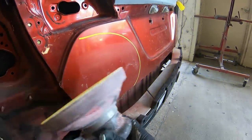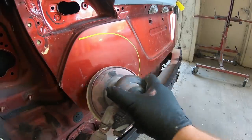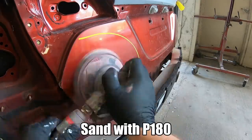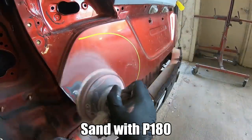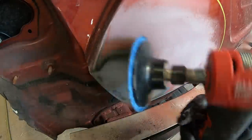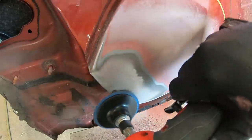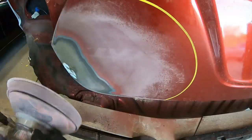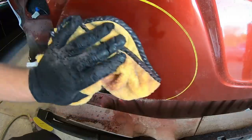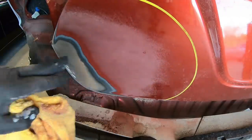Moving along to the back, we have a new piece of 180 grit on our sander and we're going to hold it flat — we never want to dig in. We're going to take the paint off right into this area where the dent really was. I've got it all sanded down; there's still a little bit of paint here so we'll use a little bit of a grinder to get into that small groove, and then I go back over it with 180. Once again, make sure we clean with our solvent-based cleaner. This spot is ready for filler, but we still have one more spot, so let's prep that one and then we'll swipe both of these together.